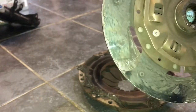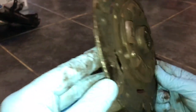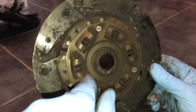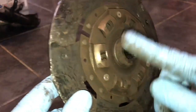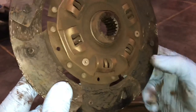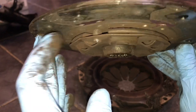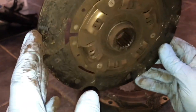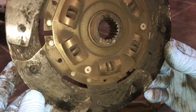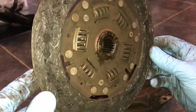It gives you a good indication as to how little material is on these clutch plates. As you can see, the design of that, you've got where the main shaft comes in from the gearbox there, and it's spinning this, so all of the drive of the car is going through these tiny little springs, and then it's going through this flimsy metal here, look. All of the drive of the car is going through these tiny metal plates here. Look how thick they are. You're talking, well, God, not even an eighth. They're 2 millimetres? It's unbelievable, really, that you can get so much power through that to drive a car. But it works well, you know, it's tried, proven, tested and all the rest of it.